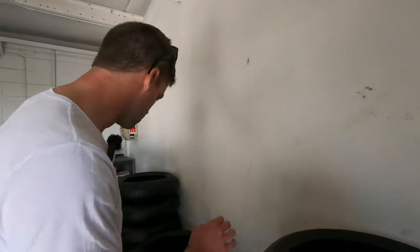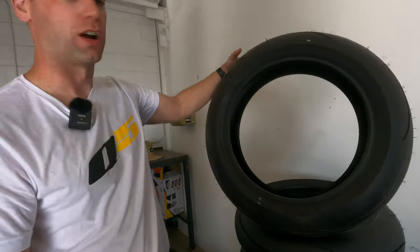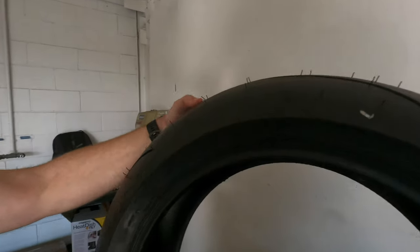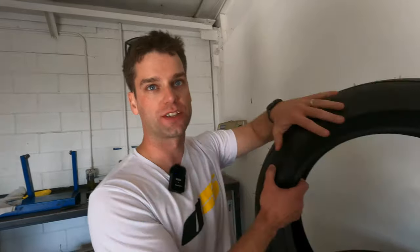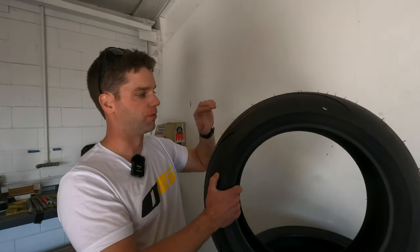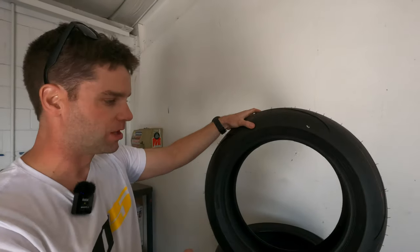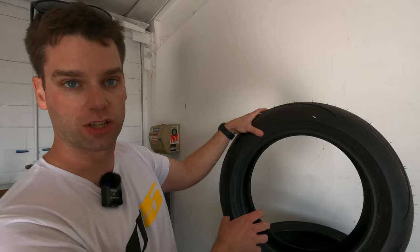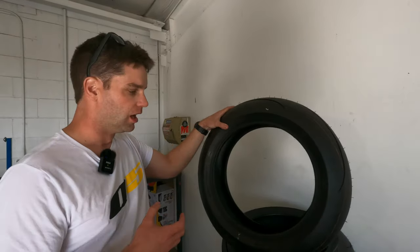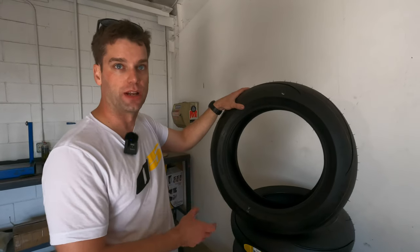Can you walk us through the Q5 rear? This is our Q5 rear — our 260 profile. Look at that big boy — that's a lot of rubber. Same concept: we want a taller tire so we can give you more contact, more grip where it matters when you're leaned over. You're going to notice a big, huge sidewall. Other than the tread grooves you see on the Q5, this is the same exact profile and shape we use in Moto America. We do a few things differently in construction versus the race tire because we want it to be more street-friendly — you don't want to be rolling around at 20 PSI on the street — but it's got the same advantages of a real race tire.